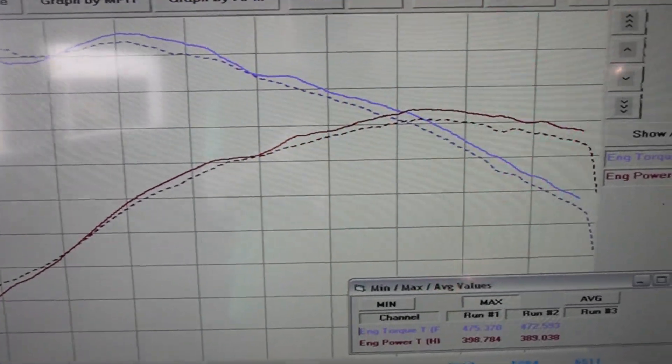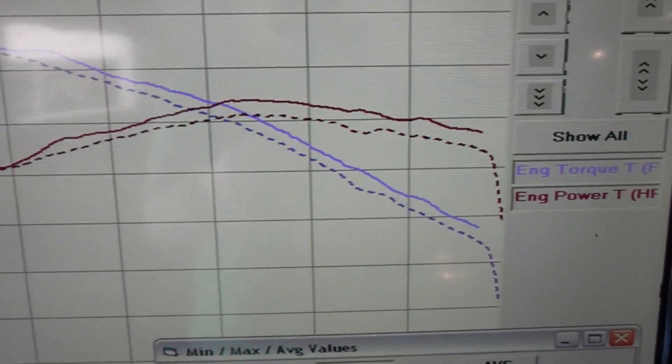Before I get to the numbers, a reminder: this is an all-wheel drive Mustang dyno and we show uncorrected numbers. These are not Dynojet numbers — not Dynojet calibrated. So my numbers will likely showcase quite a bit lower than the majority of other B9 owners who show Dynojet numbers. My reason for doing that is to prove that dynos vary from shop to shop. What I'm trying to show is the before and after effect of an install. I'm using a stage one E85 tune; there are higher power tunes at stage two with more bolt-on parts like a downpipe where you might gain more.